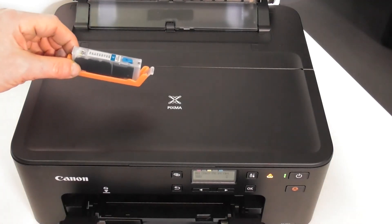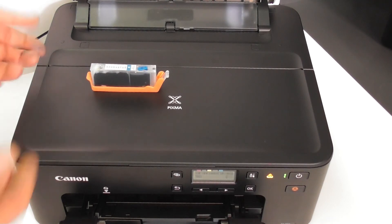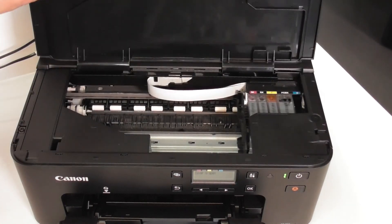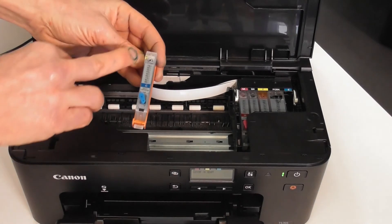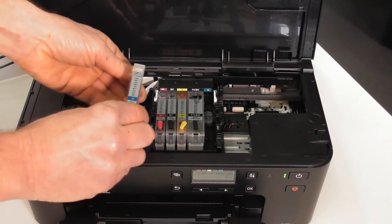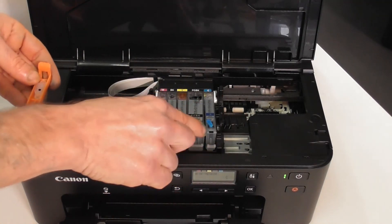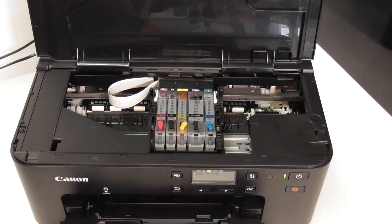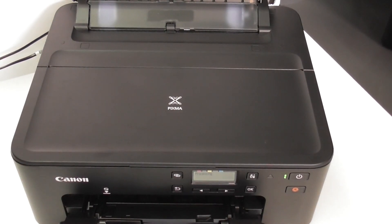So I'm going to pop this in the printer now and we're finished. As you can see, they are quite simple to use — it's really easy to refill, comes with the bottles and everything if you've ordered it with ink, and then you're just going to pop it in the printer. Now when you're taking it off the orange cradle, I would recommend keeping your finger over the breather hole at the end — it will stop any excess drips happening. First time around, it never happens. Pop that in, and we're done. It's as easy as that to use a refillable cartridge for Canon printers. And that's the latest video from City Ink Express — thanks for watching.